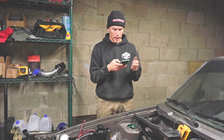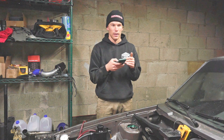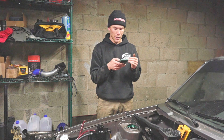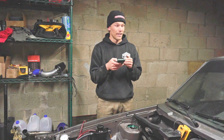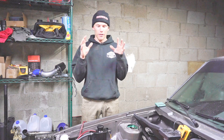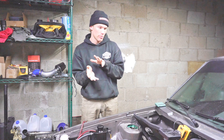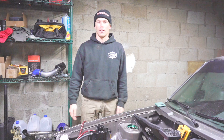Looking at my notes, from slowest to fastest: I have 0.031 inches (about 0.8mm) — I said 'not bad.' I've also tried 0.037 inches — my notes say 'feels pokey, takes a long time to build boost, top end feels open.' Then 0.0385 inches (about 0.95mm) — noted as 'nice.' And 0.039 inches felt peppy but maybe too advanced. Pump timing is variable because your injectors pop at a certain pressure and your pump develops pressure depending on head size and whether it's a turbo diesel pump.